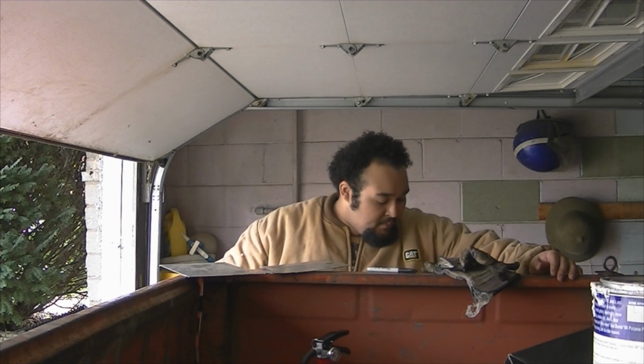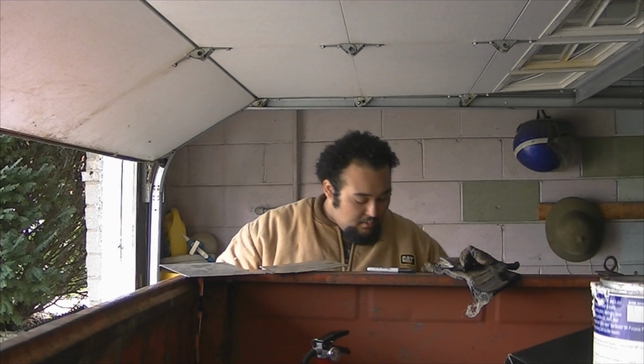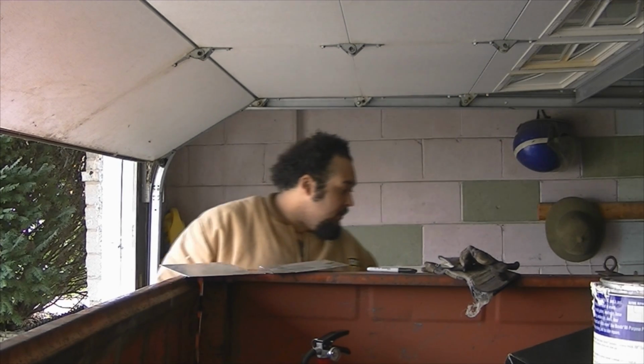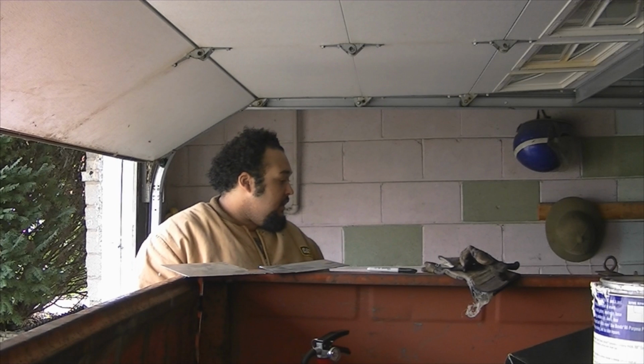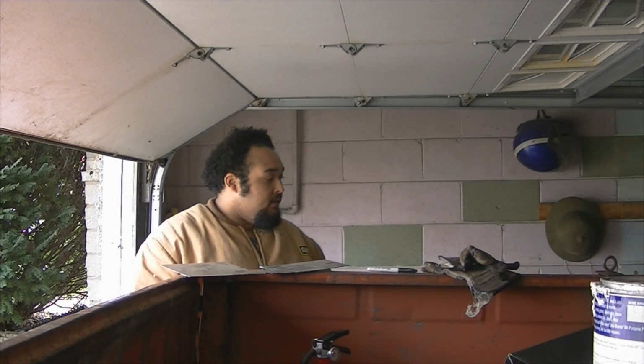So, I've got a buddy coming over to help me a little bit later, but for now, I'm going to try and weld as much as I can on this side. There's a couple holes here that I think would be rather cumbersome to get to with welding, so I might just try and use some tiger hair Bondo on it. I've got regular Bondo to fill up the seams in between where I burned through in the metal, and let's get to work.